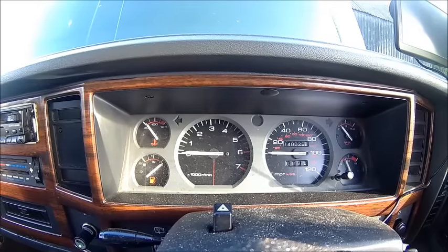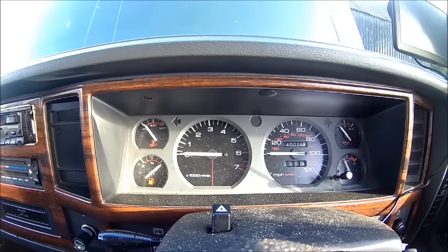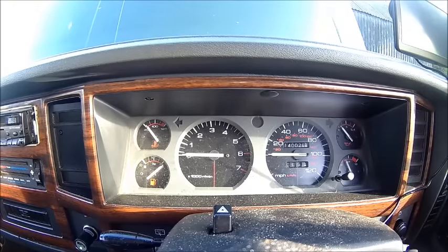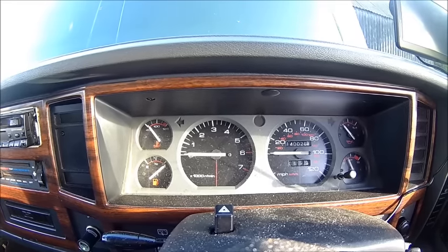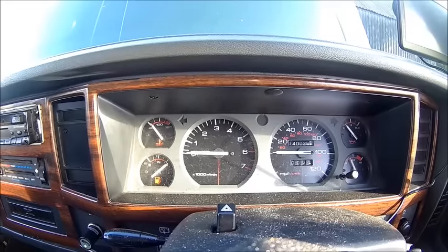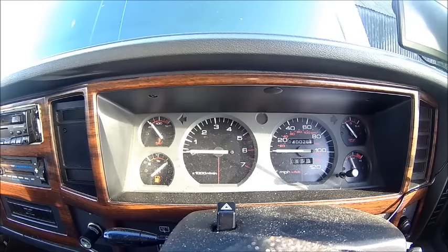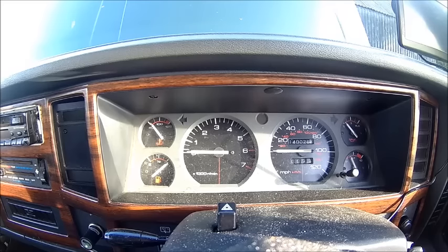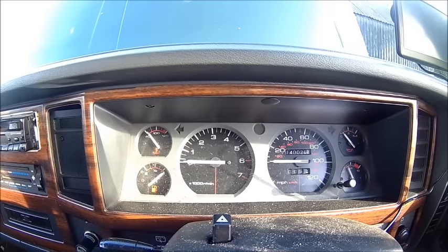Today we're looking after the Jeep again. There is a bit of a knock — it actually sounds like a rod knock, but it disappears about a minute after start. Drive off, put a bit of throttle on and a minute later it's gone. A rod knock would have low oil pressure and it would take considerably longer to build oil pressure up. Piston slap is one possibility, but apparently a common thing on the Jeep Cherokees is the flex plate, so that's what we're going to check today.